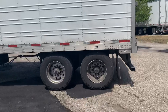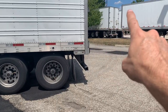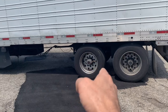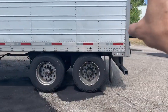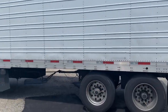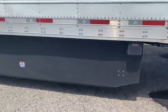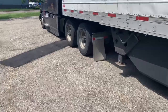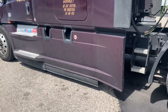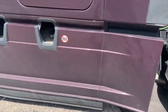If I wanted the weight shifted to the rear, same process — I'd just back it up instead of pulling forward. Back it up, those wheels would still be in the exact same spot, the trailer would go back here, and the wheels would appear to be up here further forward. If they didn't move the whole time — you're just shifting the trailer over the top of the wheels. Wheels stationary, shift the trailer forward or backward over those wheels. Once you actually physically do it a couple times, the concept gets a lot easier.